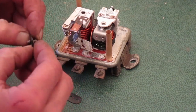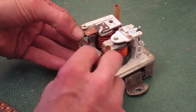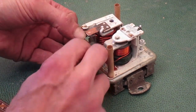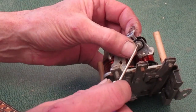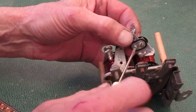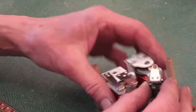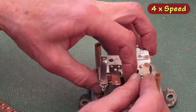The steel plate keeps the screw from squashing into the plastic. Look at it from this side and verify the plastic will keep the screws isolated. Then this other plastic piece goes on. The holes in this plastic are squashed in a little bit, so I'll screw the screws in to hold the plastic parts together. That looks good. Now I'll bend the wire to get it into position.